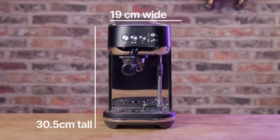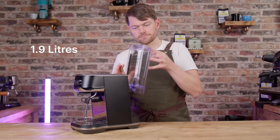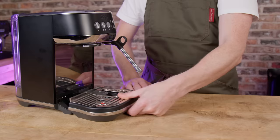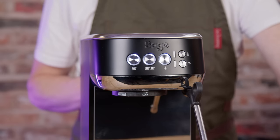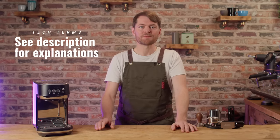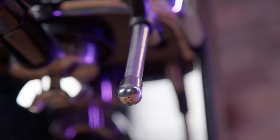First, the specs. Dimensions: tiny at 30.5cm tall, just over 19cm wide and 35cm deep — much smaller than something much bigger and slightly smaller than something slightly bigger. It has a 1.9 litre water tank, officially taking 2 litres if filling in situ. It has a small drip tray, which we'll come back to. It features a Sage or Breville Thermojet — their newer faster thermocoil — giving a crazy fast 3-second warm-up time. It has a 3-way solenoid valve, a 9-bar OPV, and a PID with a fixed brew temperature of 93°C / 200°F, plus low pressure pre-infusion.